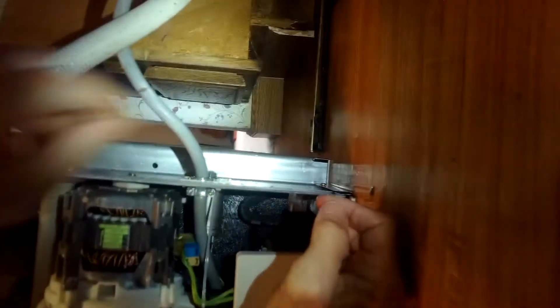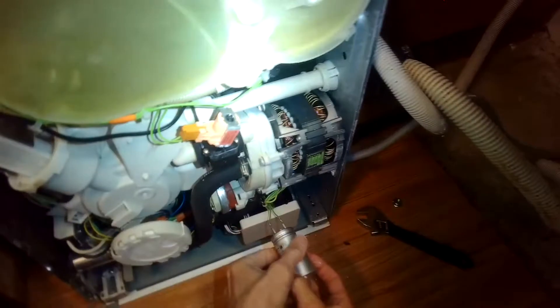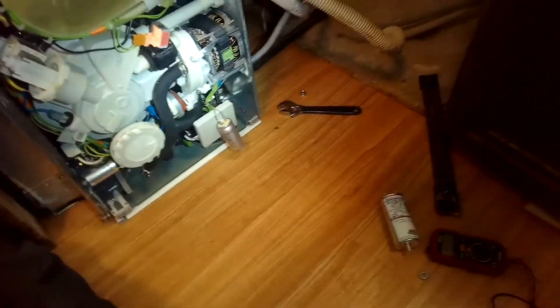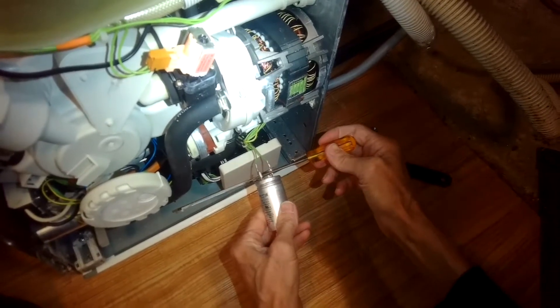For the capacitor, it's hanging out right there. To get to it, remove a nut right there, take that off, and then we can get the capacitor out. At this point it's good to ground out the capacitor — you don't want to touch those terminals because it can hold quite a bit of voltage. Ground it out using an insulated screwdriver, going between the two terminals, which should drain out all the juice.